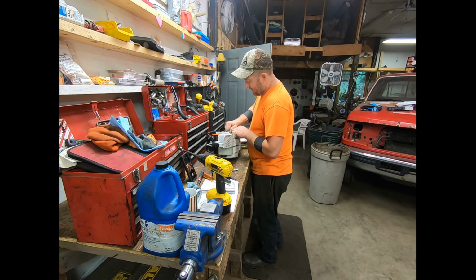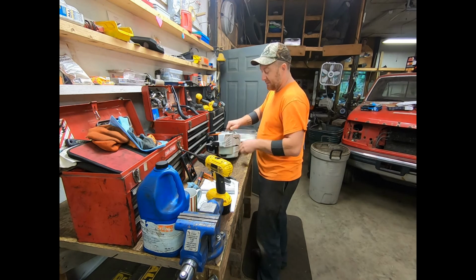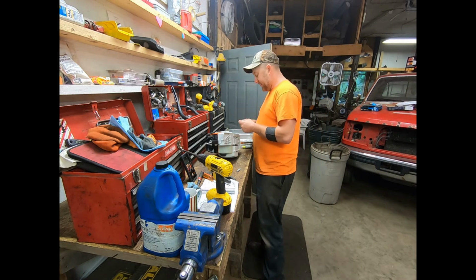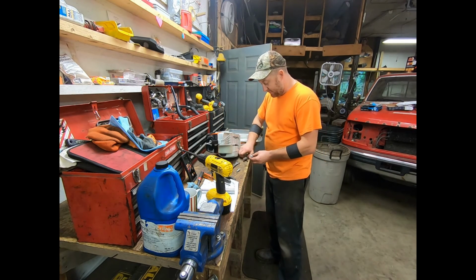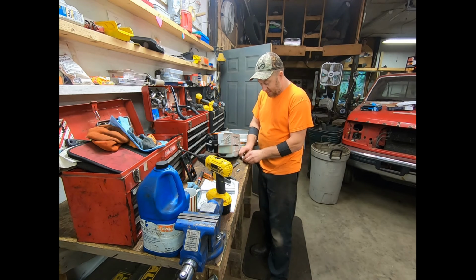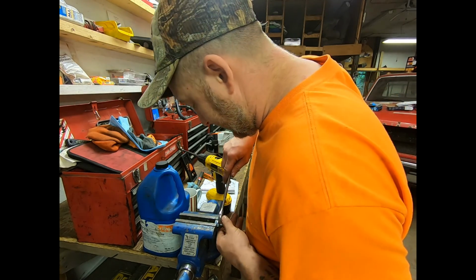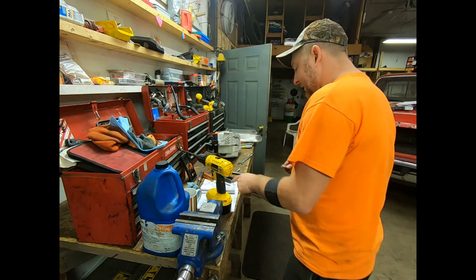So anyway, a little trickaroo I learned back in Vietnam. You'll take one, basically to the shoulder, two right to it, and then you bring the one on the bottom back in line with the front one. It's what's called a jam nut. The concept is you're jamming the one up against the other. I think it's going to be better off in the vise, just because everything's too loose right now. Just make them line up just enough to where you can take the old socket that you had earlier.